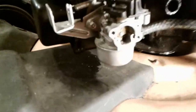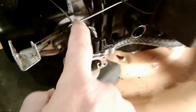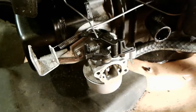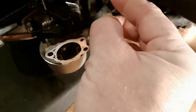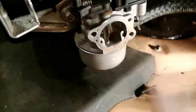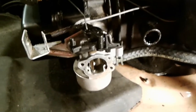What I want to do is change out this carburetor. The reason is it still works okay, but what happened is on top of the carburetor there are some plastic components that are part of the automatic choke system, and one of them broke off right there. There's a spring that runs from this post here over to here that controls the choke plate — the spring was missing, and then I ended up breaking this plastic tab off. It was just as easy to order a whole new aftermarket carburetor, which you can get on Amazon for 12 to 15 bucks.